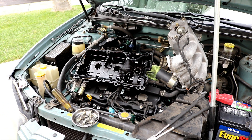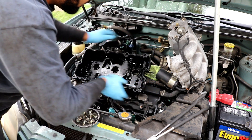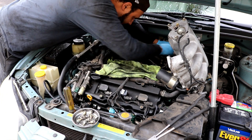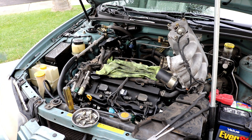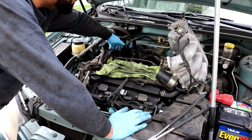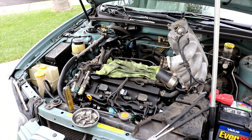As you can see, I got the wrong valve cover gasket — let me get the other one. Got that all in place. Go ahead and run a small bead of silicone in the back, then reinstall the valve cover back into place. Remember you have to get the breather hose reconnected at the same time, so do that now.